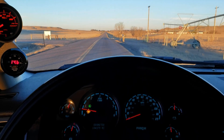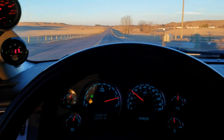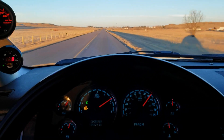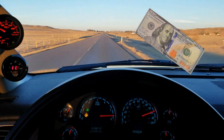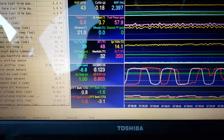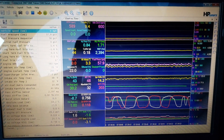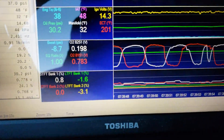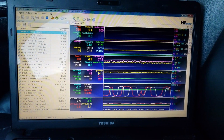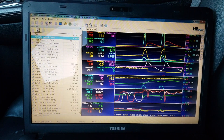A regular Yukon with this setup just has an extra few hundred horsepower or more if you want — if you want to pulley down or whatever. Budget setup wise, to get it running decent, it's not hard. Once you mess with your VE and your MAF, tune them independently, and then still use the blended mode, it really gets you pretty close to a stock driving vehicle — you would never know it has anything done to it. Throttle response is there, everything's great.